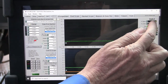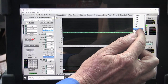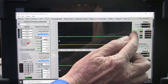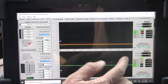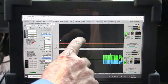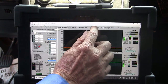I want to set the scope up a little bit differently. I want to turn off some channels so we don't get confused, and lower our voltages to get a better look at all this. So now I have CAN high on the top and CAN low on the bottom. If I push the button, I can see that I have something. When I push the button, we have something happening on these lines — so I want to go look at that.